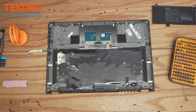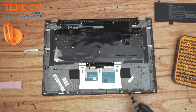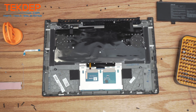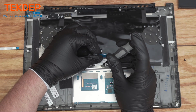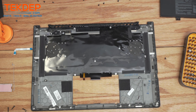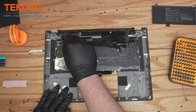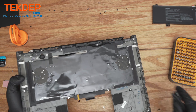There are also secondary speakers here — not as strong as the main ones. Flip it around because there are a few more screws in the mousepad. You'll see two exposed screws, and there is one more hidden right under the connector. To get the mousepad out, just lift it up and it slides right out. What's left is the power button — push it from the other side and pull it out; it's just adhered on very lightly.